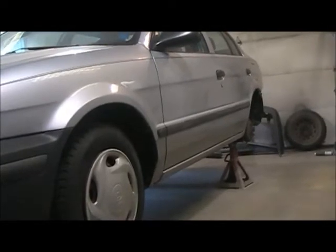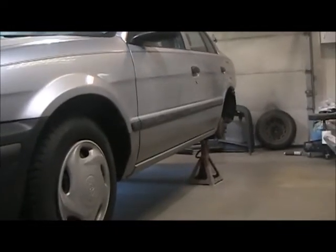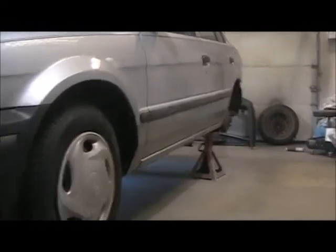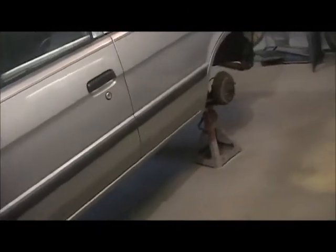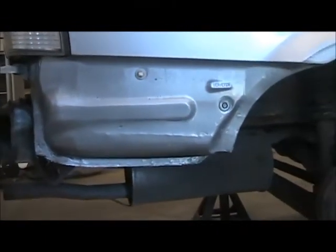There we go, it's all cleaned up. I'll let that set tonight and tomorrow I'll come out, put the bumper on and mud flaps, take it outside and give the rest of the car a good bath. It looks a heck of a lot better — it's rough but she's sealed up now, probably even waterproof. I put a lot of seam sealer in around my welds. I still gotta undercoat it — I'll give that a shot along where it was rusty, I scuffed it off first.